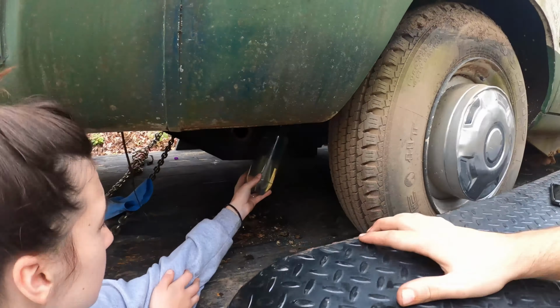The battery is totally junk, so I got a little jump pack right here. And in essence, if I turn the key over and the engine's turning over, like I explained how a mechanical fuel pump works, fuel should come out of this line. And if fuel comes out of that line, that means my fuel system is operational. Ready?